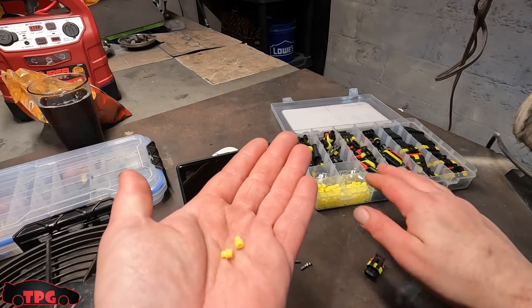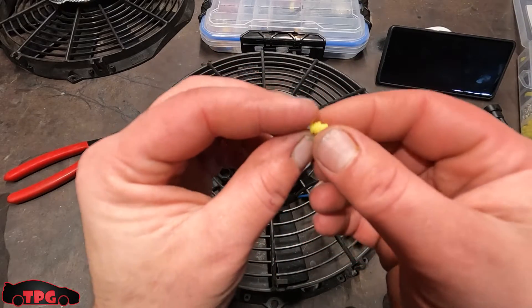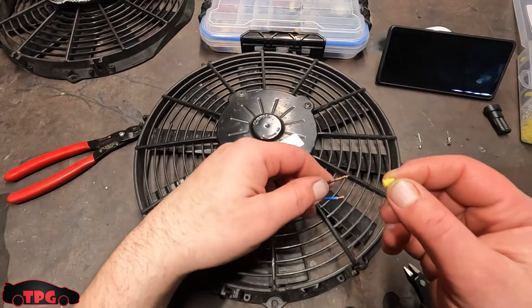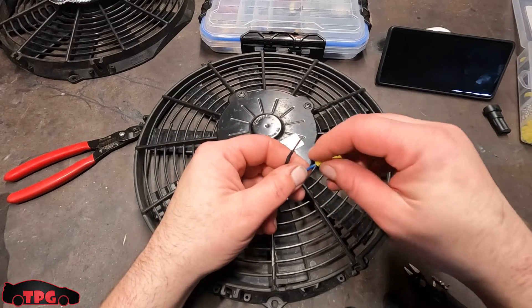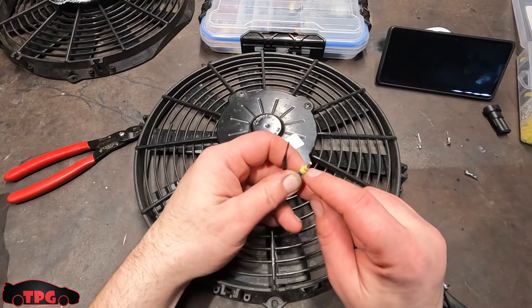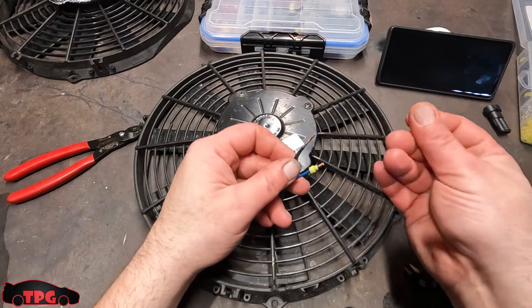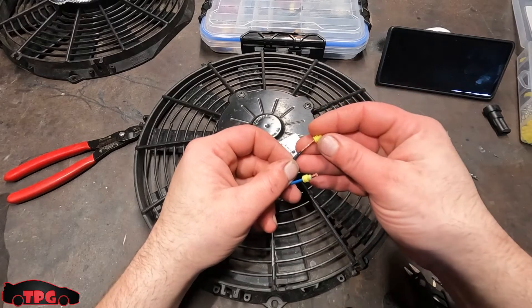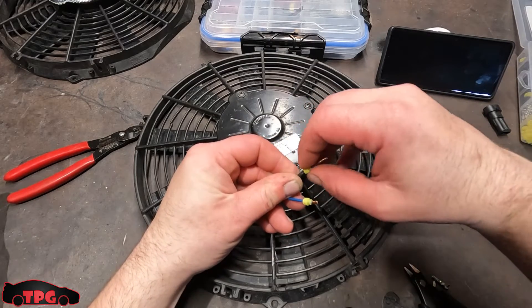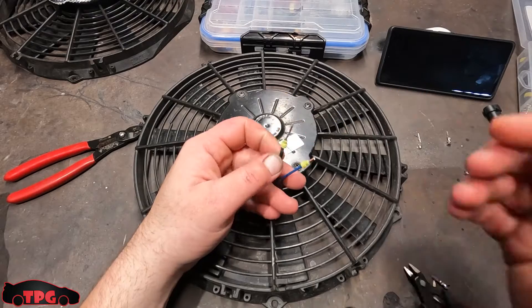Come over to the fan. The little cone end of the insulator hangs off the other side, so slide it onto the wire and twist it on so the copper part is sticking out and the blue sheath is showing around the edge. Do the same with the black wire — it's like a little cap that goes over it, just twist it on in place. You can see just a little bit of black showing at the end.